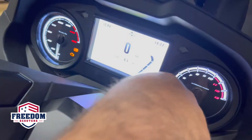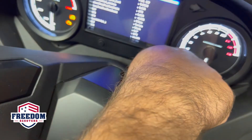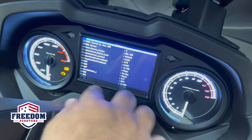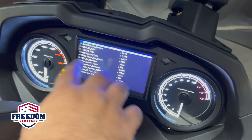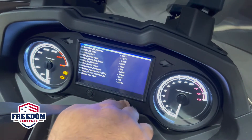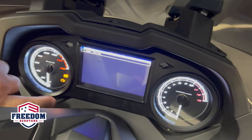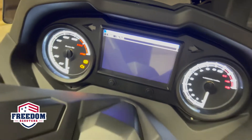You can actually look in real time. I don't have the engine running right now, but I'm going to go into the menu and let you see. You hold the button down for five seconds and it'll show you DTC codes stored in the ECU — currently zero. You'll see that the MIL illumination is off. You can look at things like Spark Advance and RPM. There's another screen of additional data — these are all of your sensors. You can check all your sensor data right from the dash. If a DTC code is thrown, you hit the left button and it brings up any stored codes. Right now there is no fault — nothing has been logged in the ECU.